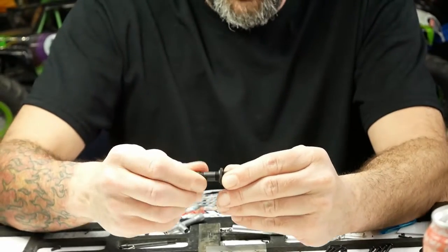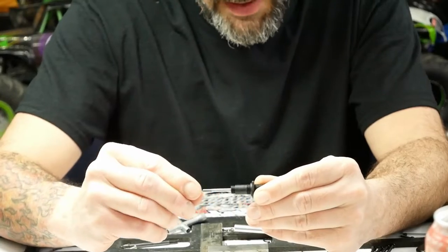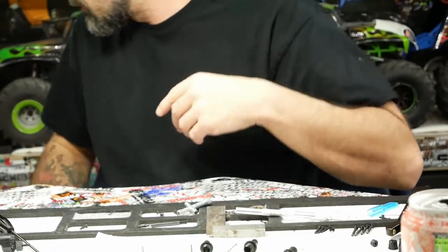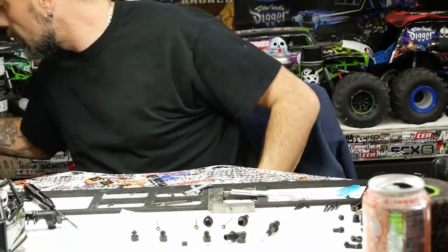We are going to do it properly. We're going to take out the seal pack on the bottom. We're going to use some CowRC grease. Pack the seals in grease and then tighten them up, and that's going to help keep everything sealed tight together.